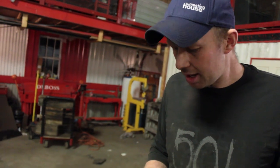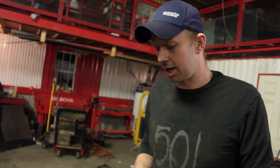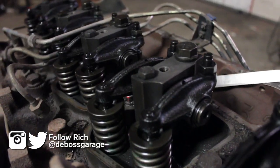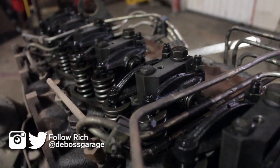That's all there is to setting the valves. It should be done every 50,000 kilometers or so. If you don't know when the last time it was done, or it's extra noisy when you first start up your truck, then it's time to set your valves again. It's a cheap way to quiet your engine and make sure it's running at its optimum potential.